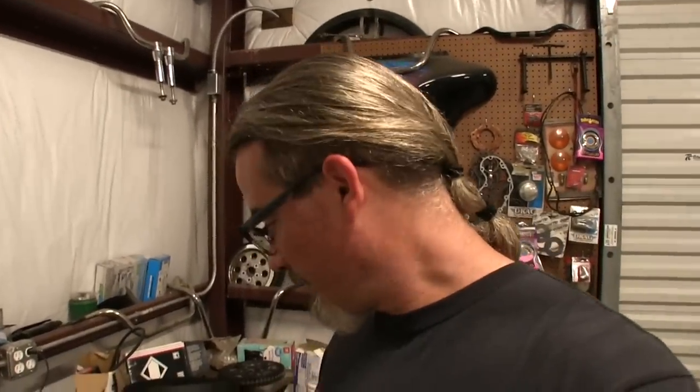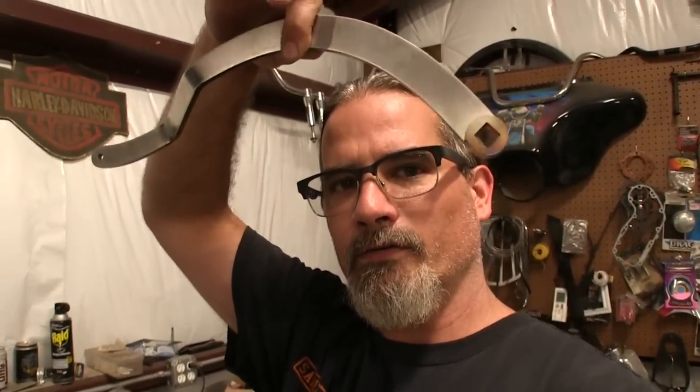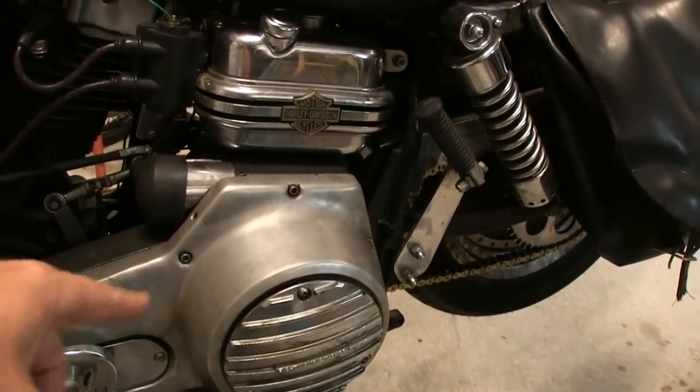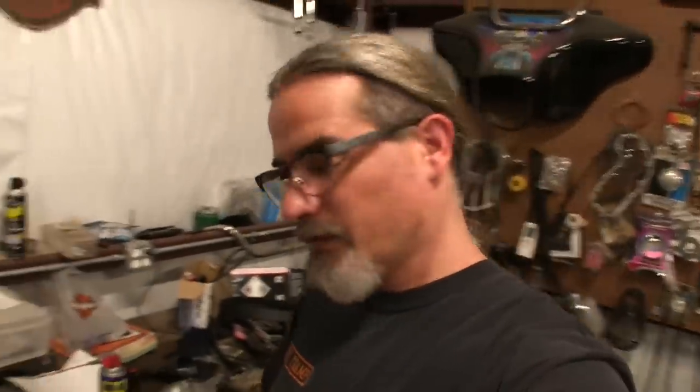They sell chopper stuff, and I bought some chopper stuff — namely this little piece right here, which is an arm bracket that goes on the transmission for a cow pie transmission if you want to operate a foot clutch, and also one of these jockey shifts for a cow pie transmission application. The reason I mentioned the electric start is because this won't work with that primary cover, inner primary, and solenoid in the way. This motorcycle is a belt drive on the primary.